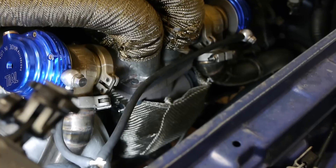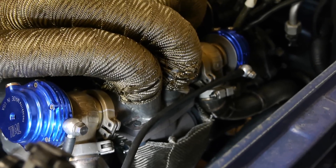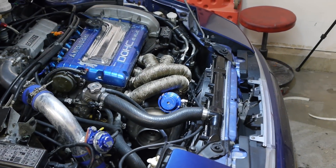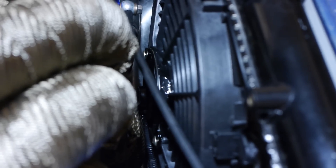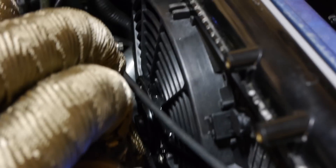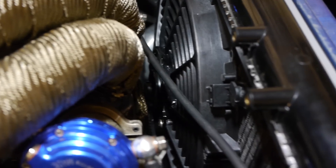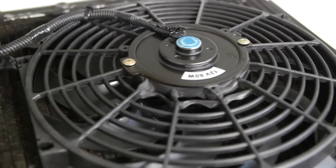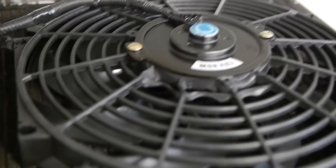There's my turbo diaper — I just pull it up there. Diaper installed. That should fix our problem. Except it didn't fix our problem. I just got back from a test run and it still melted the top of the fan. You can see that shiny bit of melted plastic right there — it's hard to see because it's black, but it's melted to hell. So that fan is toast. The turbo blanket couldn't even fit between the turbo and the fan without touching it — that's how tight it is. And it melted the fan anyway.